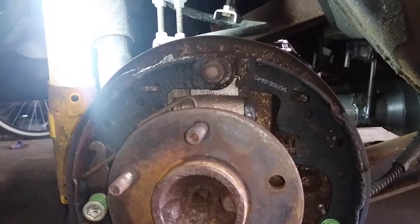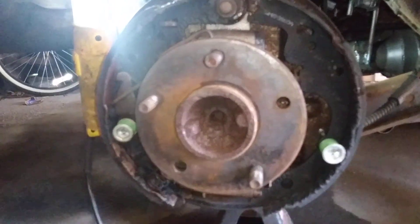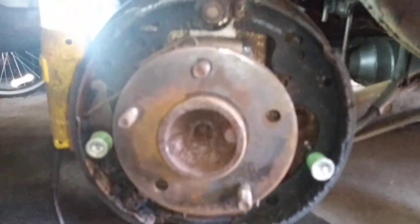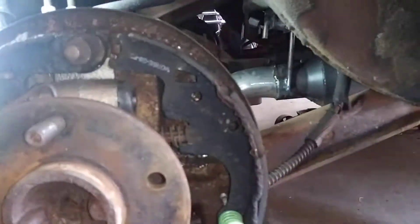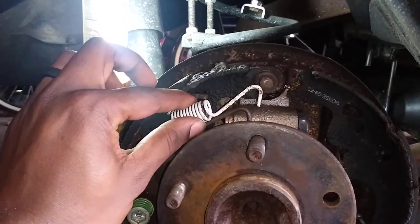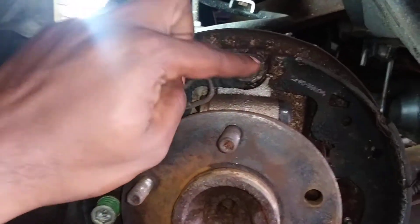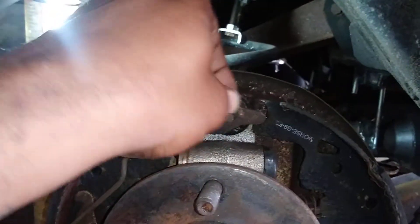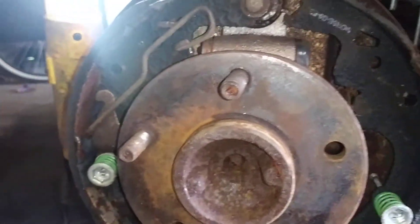I'm doing a rear brake cylinder on a 1984 Buick Regal. I'm going to replace the studs too. How I'm going to do it instead of taking it all apart — what I already did was I took the blue spring off from here and I took the white spring off from here. You also got to take off this little doohickey here and go around there, and this piece goes on here like this. But instead of going through all of the trouble trying to go behind it to break the little bracket off the back, which looks like this —